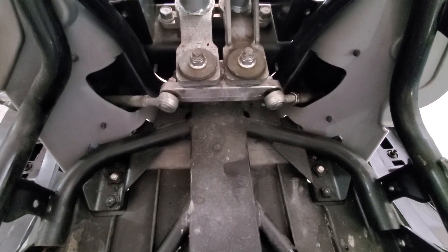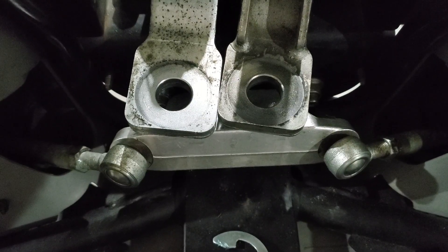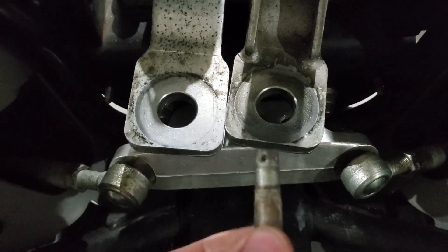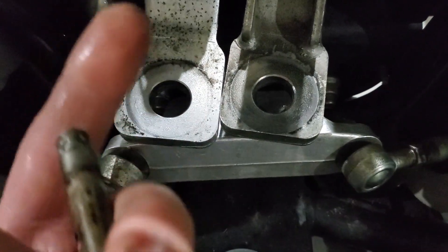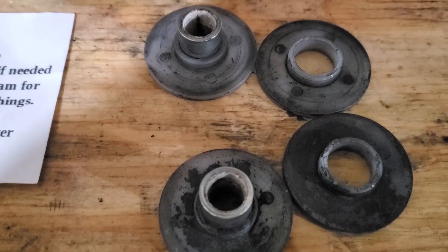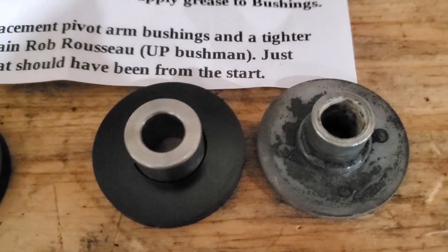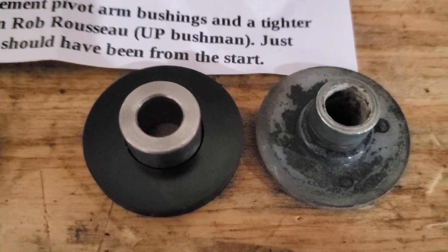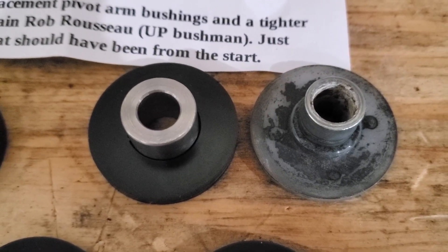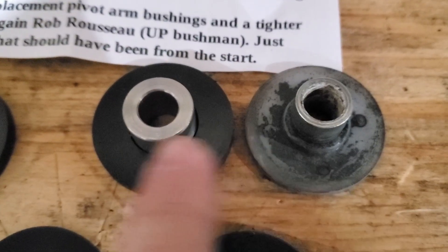We'll go from there — now we're just waiting for the kit to arrive in the mail. And when it does, we'll continue the video. Okay, so the kit has arrived. What I've already done is taken apart the steering section that had the looseness in it. There was a bolt that went up through the bottom of this hole with a nut and plastic washers on it. So these are the worn out plastic washers. You can see in comparison: the one on the right is the original and the one on the left is the UP Bushman replacement — you can see it's a lot heavier duty. The metal part is a lot more substantial, and the plastic part is basically a spacer. The important part is that metal — I think it's stainless steel on the UP Bushman one.